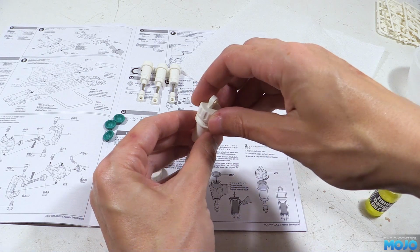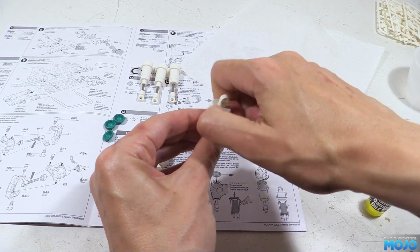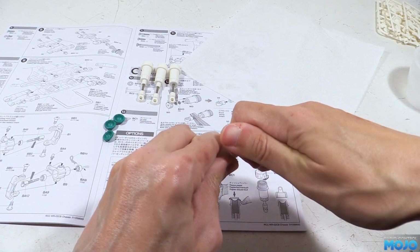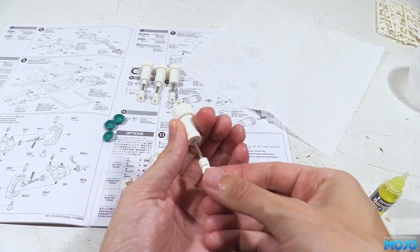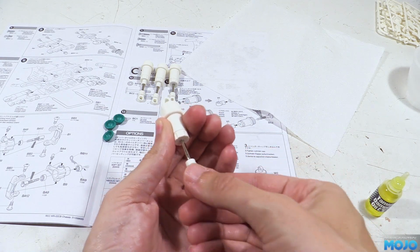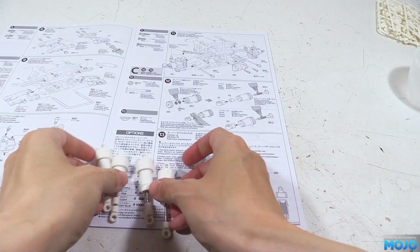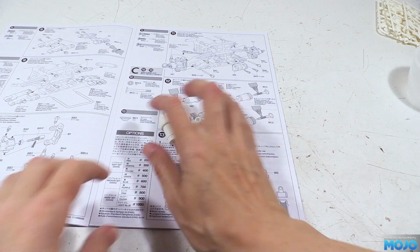Wipe off any excess and thread on the top cap. Just like the bottom, we need to make sure it's bottomed out and done up by hand. You should find the shaft moves in and out super smoothly with no catching or grinding. If you built them carefully and they do feel a bit rough, there's a good chance you've still got a little bit of air in the oil. Just pop the top off and have another go at filling them up.